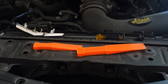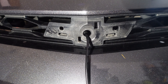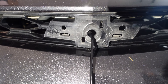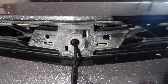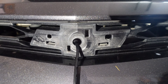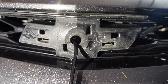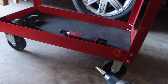Half the work is done — it's time to start installing the new one. There was no hole in the middle. I almost forgot to record this part, but I had to use my step bit and drill a nine-sixteenth inch hole straight through the middle, and that was enough to push the harness through as you can see. They've got crosshairs in the middle that let you know you're centered. There's the step bit.